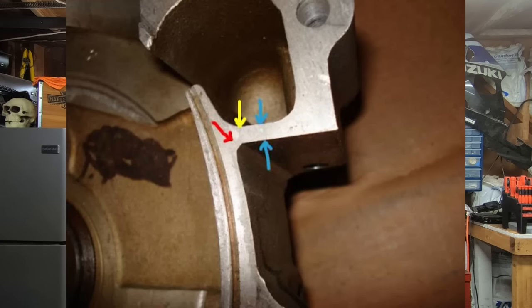So you can put any cam you like in your motorcycle — you just want to tailor that cam to where you ride the most and how you ride the most. For today, I really want to keep it simple, especially on the Evo engine, because you don't want to put too much power into it or you can start to have some problems. So by keeping it simple today, we're mainly going to focus on straight bolt-in cams. That means you're going to retain your stock lifters and your stock push rods. But later on in the video, I am going to give you some suggestions on what you might want to change when installing your new camshaft.